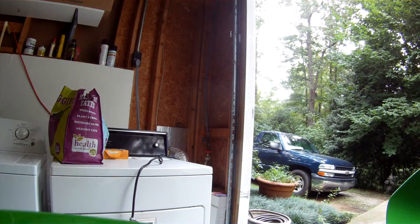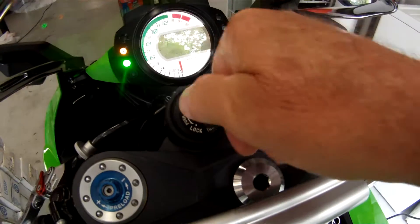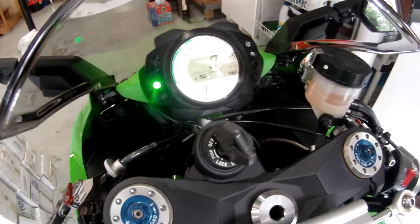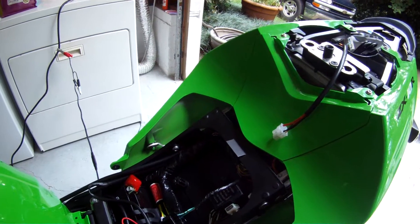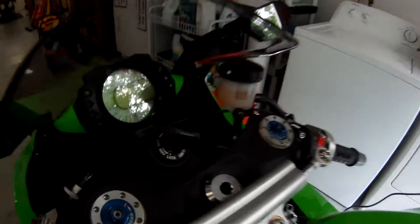So we'll shut the bike off and install the jumper. When we turn the key on, it will default back to MS1, and the bike will start up. The map switching from MSO to MS1 when we install that jumper is not switching on the fly — we've got to cycle the power from the key.